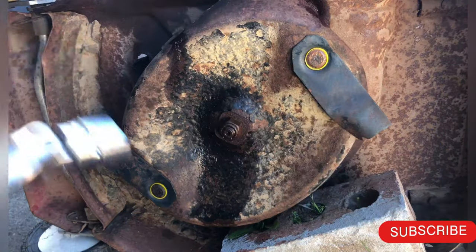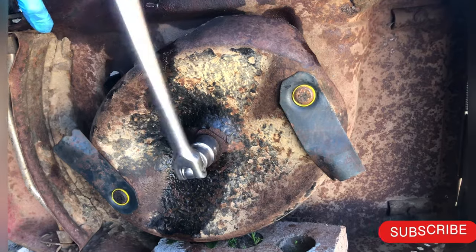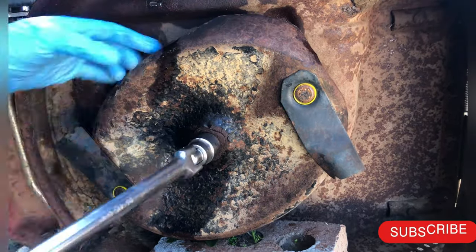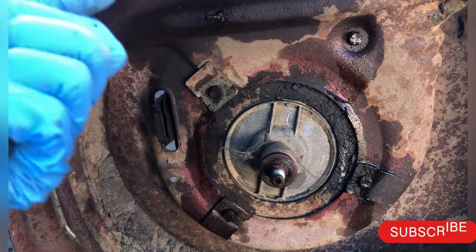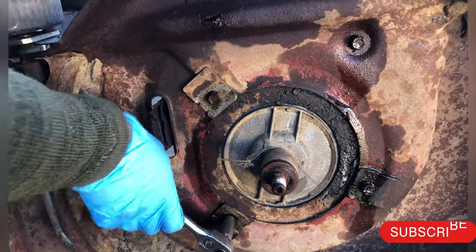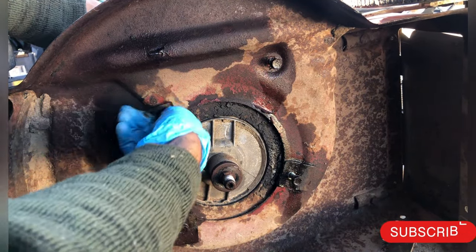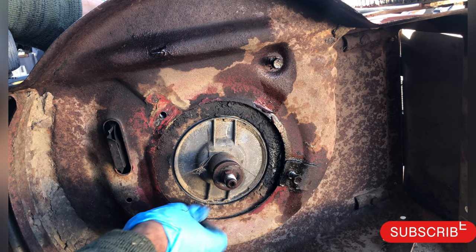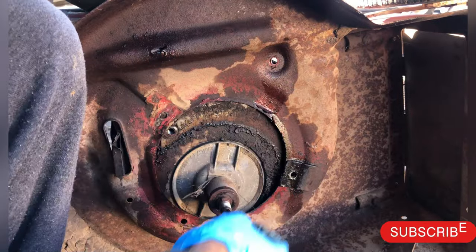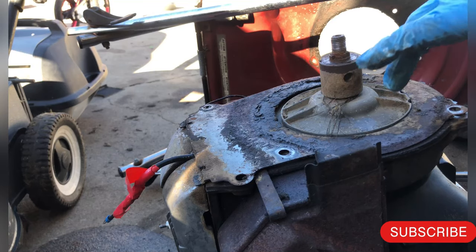That's a 24mm socket. I got a brick underneath so it doesn't move. You have to get four bolts out — keep holding the machine with one hand. When you get to the end, just keep unscrewing the bolts, keep holding. Slowly release it and now it's out of the deck. Get the plate off.